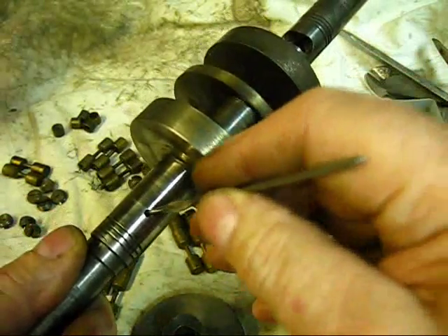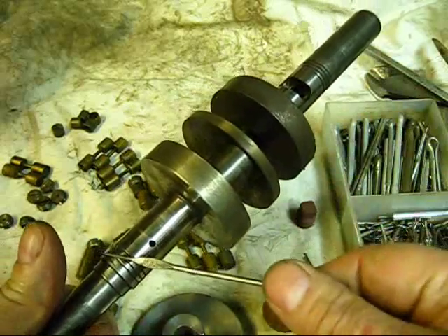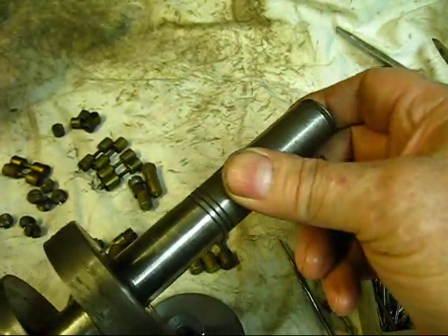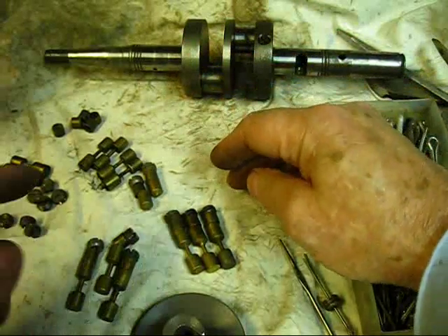They made that hole go all the way through that crankshaft right around to here — you see that hole in the crankshaft? That's for lubrication. You should not be using seals in the end of these crankshafts. There's a reason not to use them; it's only supposed to be an oil slinger out there.